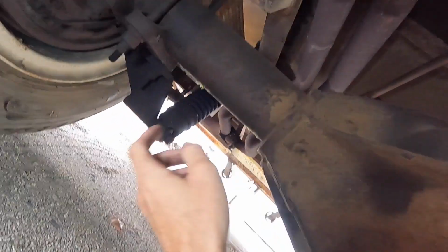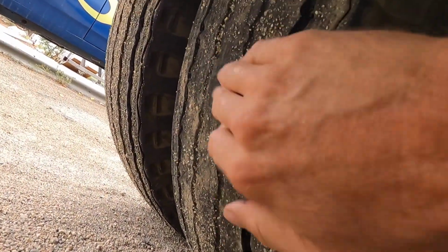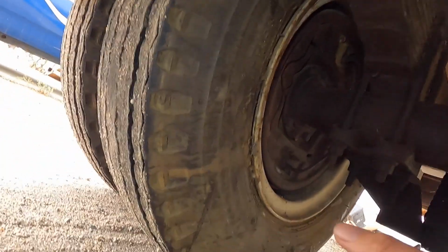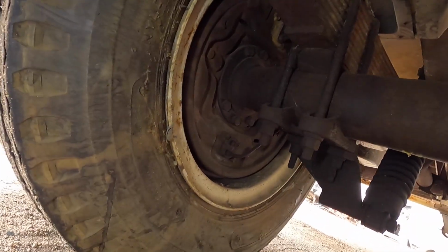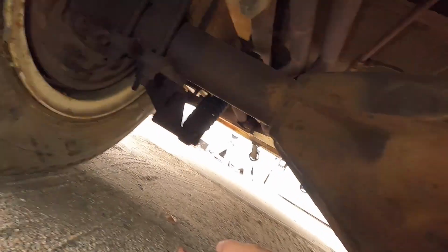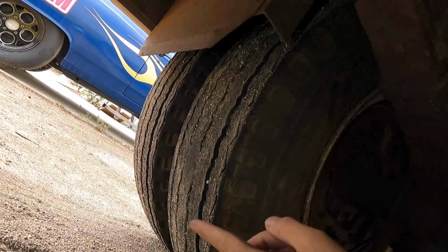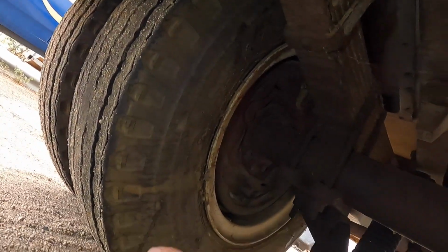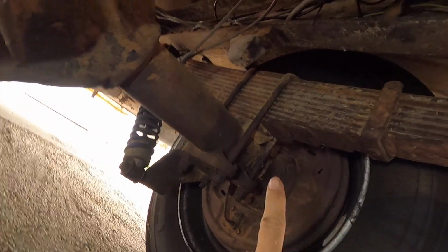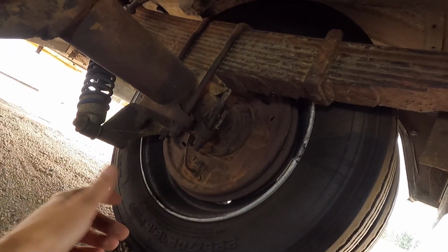Let's do this. So I'm betting it's the drive side, right? Ooh, look at these Bernie boys. Because in the forward motion, when it let go, it free revved, but I was able to back up. So what I'm hoping is that this is your drive tire on an open differential, right? It wouldn't drive forward, but when I put it in reverse, it clunked and it went backwards. But if you drive the gear set in the opposite direction, this would become your drive wheel. So if this axle was attached, it would still move. That's what I'm telling myself.